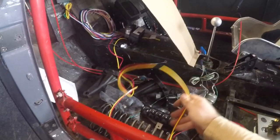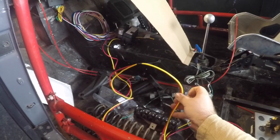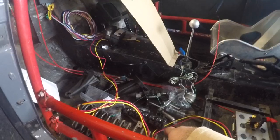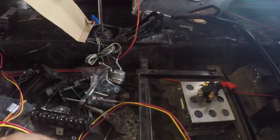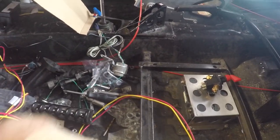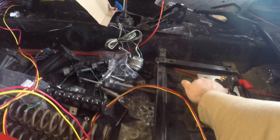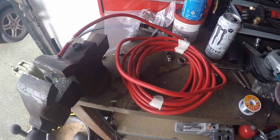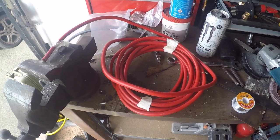These are my main 12 volts for the fuse box and ECU fuse box. So they're really long. So I think now what I'm going to do is make the battery positive. It goes from here round to actually the switch, which is going to be up there. And that involves then at this end actually connecting this red cable to it, and also making the little flying lead as well. So I'll do that now. This is the main battery cable I'm using. It's big chunky 170 amp stuff.